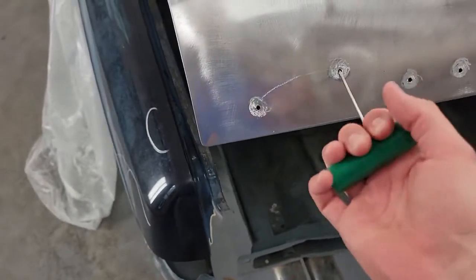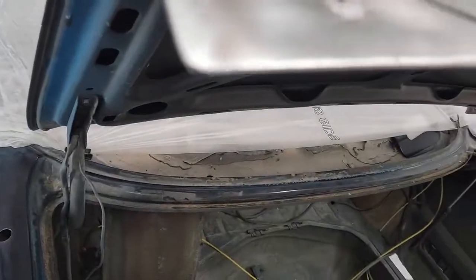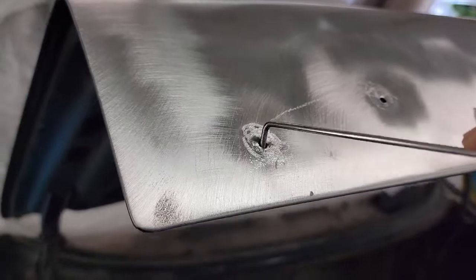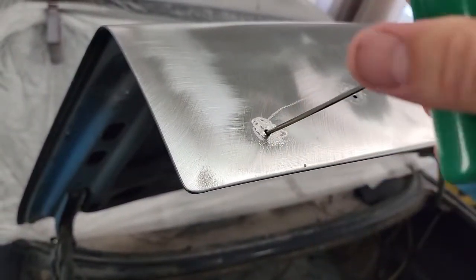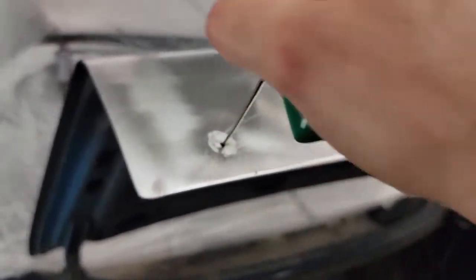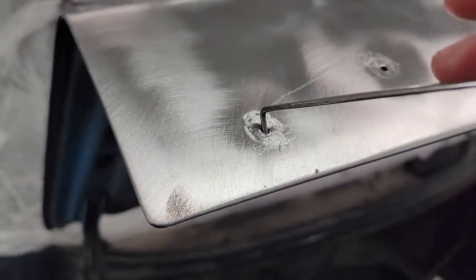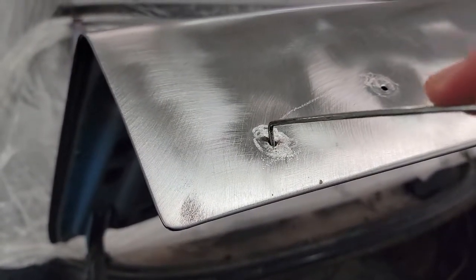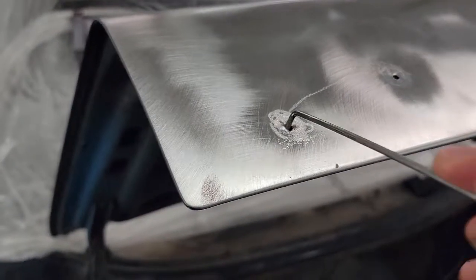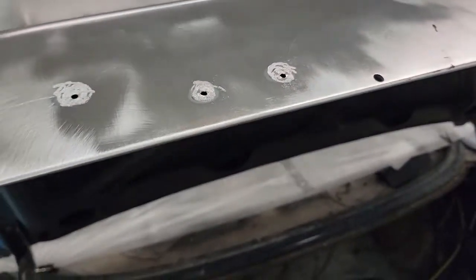Slowly pull the hole out. Down here, since the inside of the panel is so close to the hole, I couldn't get down this direction. It'll only go in from here and then I rotate it — it'll only go about right there. I can't turn it all the way around. So what I did on that hole is I just pulled it like this and rotated it around, and that pushed this part of it in further. Then I was able to go around all the way around the hole on these bottom ones.